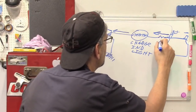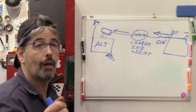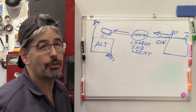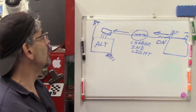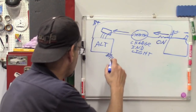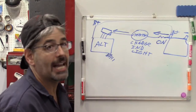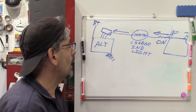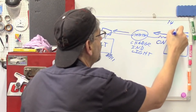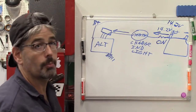When you turn the key to on, one of the things you will notice on any car is that the charge indicator light comes on. That makes sense — battery is feeding the light, and it's grounding out through the alternator, which is not spinning because the engine isn't running. So we've got a regular simple light bulb circuit. The trick is when the alternator is running. What's going to happen is the alternator is going to be producing the same amount of voltage as what you will be getting from battery voltage — somewhere around 14 volts or so. So on the battery positive, we've got like 14.2 volts, which means we've got 14.2 volts coming to the bulb.